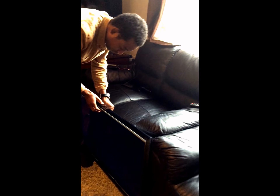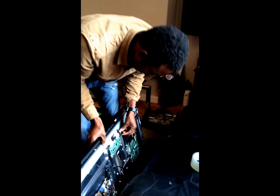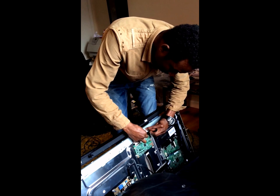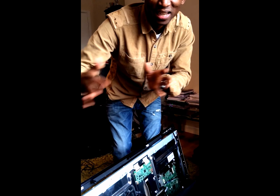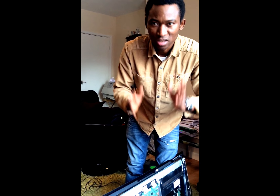So what we need to do to resolve the problem: we need to cut a little rectangle of tape — cut about a five-inch piece — and then we're going to cover this edge of the flex cable. Once we cover it and put it back, that will make more pressure on the other contact lines and fix the connection. It may not work for you the first time, so just keep faith, keep going, keep trying gently until it comes good. Don't force it — sometimes it comes right the first time, sometimes you may need to try many times.